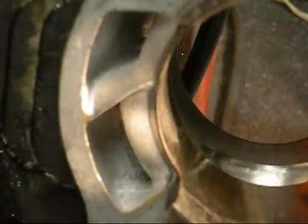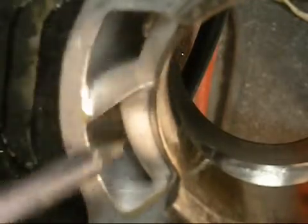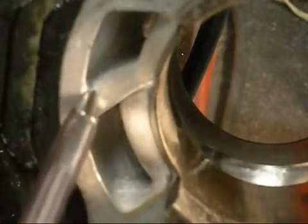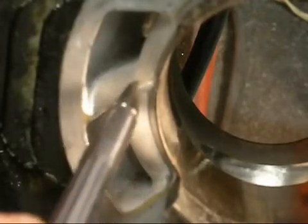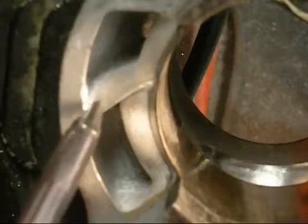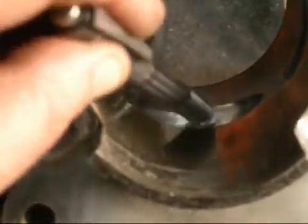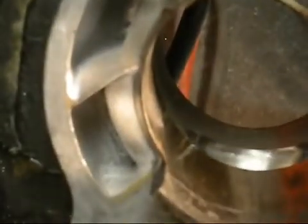Basically we're done with the transfer ports. I hit them with the blue stone — nice radius here, lost all the little lumps and bumps, threw a nice radius down in here. These aren't knife-edge — they're still flat at the top but just barely. Remember the seven degree rule, so this is all rounded off in here, same thing on the other side. I went in and did the final work on the exhaust port — that was done with a sanding drum. Still have to go in and hit it with the 600, but for all intents and purposes, for this exercise the transfers are all done.